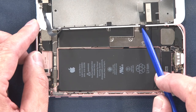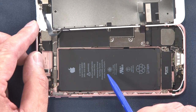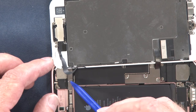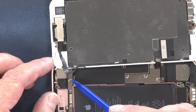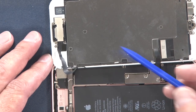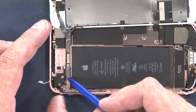We see the digitizer, the home button, and the LCD are now running through one cable across here under the same shield, which is held together by four tri-lobe screws, so we will not be able to remove those. The cable on the top here runs along another shield on the bottom — that is where your front-facing camera assembly is, which houses your connections for the ear speaker, proximity sensor, ambient light sensor, and front-facing camera.